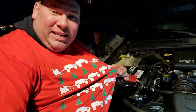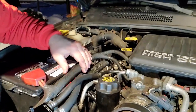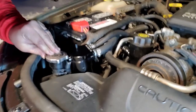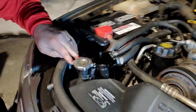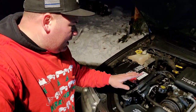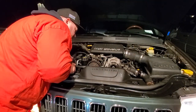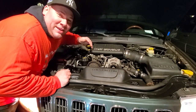The sun went down and it is freezing out here — had to run inside and put on my Christmas sweater. Now that I'm layered up, let's check out the final product. We've got the catch can plumbed up next to the new PCV valve, right next to the radiator cap — it does not interfere. You can still take the radiator cap on and off. To empty the catch can, just snip the zip ties, empty it out, put it back, connect with new zip ties — no big deal. Running the engine to check everything.